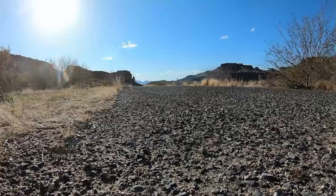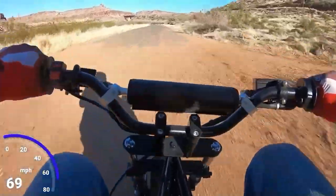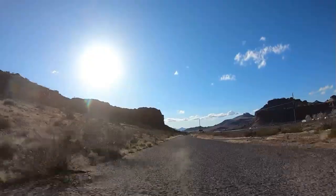So last time around, the Tillotson 225 with the Paul's Kart small chamber big valve head and a Paul's Kart cam did 68.52 miles per hour and I think 4.12 0 to 30. So this time around, to see if I can beat those times, I'm gonna add some 1.2 ratio rockers and a 28 millimeter D-slide carb.